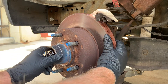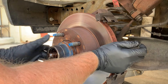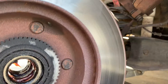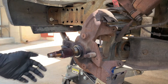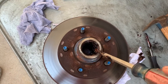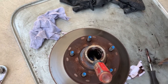There's our bearing — let's get that back up there and pull this out so we don't damage it in any way. Set it down and keep debris out of it. I've got a metal tray below me to keep everything on. You can see what our other bearing looks like on the back side. We have grease all over everything — bearing rides here and bearing rides back here. Basically, you stick your screwdriver down in here against the back side of the bearing and take a hammer and tap in a circular pattern until it pops out.